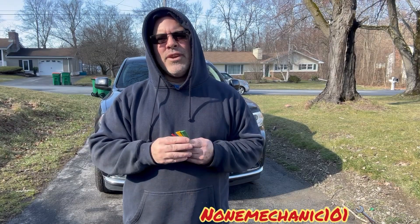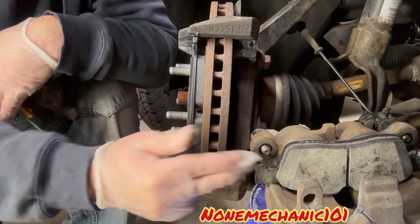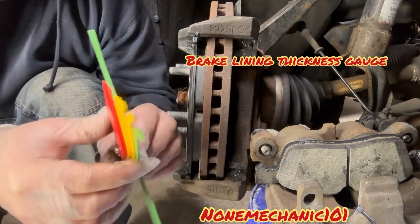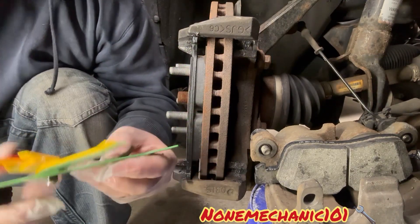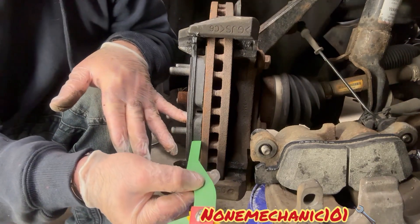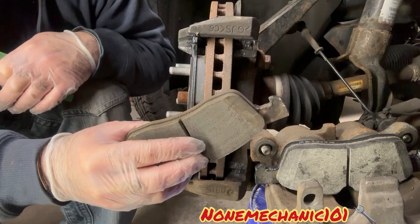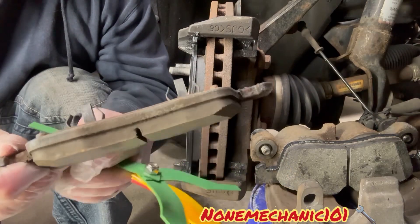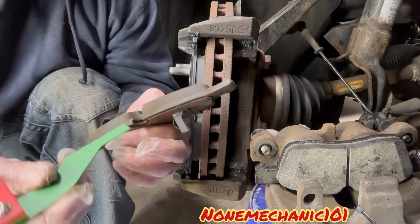To see if you really need brake pads — these are our new brake pads, the ones we just replaced. I have this brake gauge to check the thickness. It has numbers on it. When brake pads are brand new, in this situation they come 12 millimeters thick. Now these are the old ones — these are the ones they told her she has to replace. Look at them — they're worn down, and it's even. These right here are 10 millimeters.